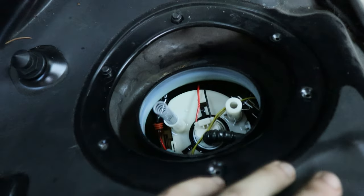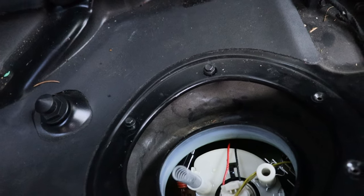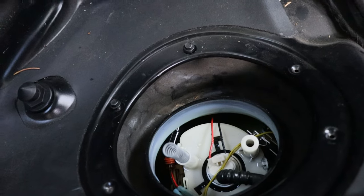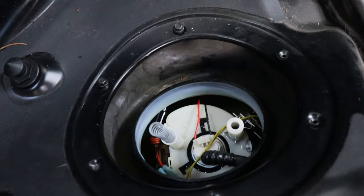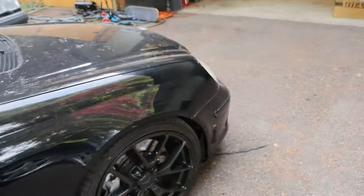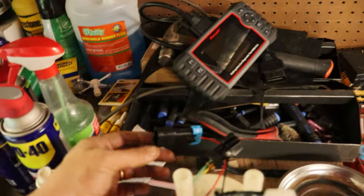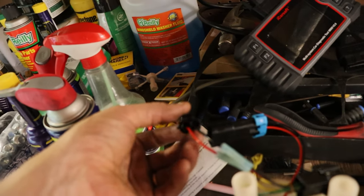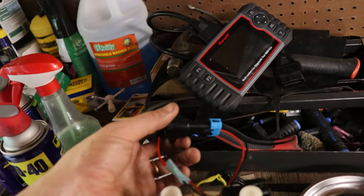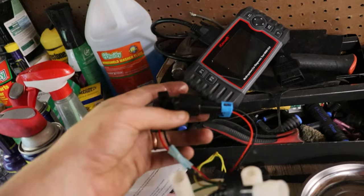Fuel pump assembly is opened up and it doesn't look like that feed line was getting pressed down, but it's hard to tell once that cap gets put on. I'm going to redo the zip ties with stainless steel wire anyway — even though they're nylon and won't break down in fuel, they will get brittle and could break over time, and then the fuel pump would just drop and be flopping all over the place. Should have done it the first time, but live and learn.